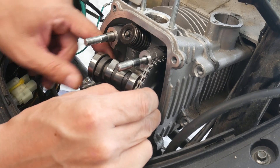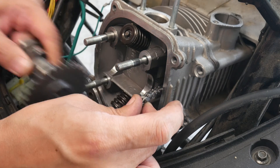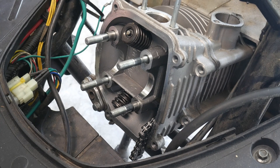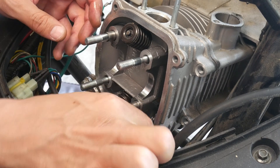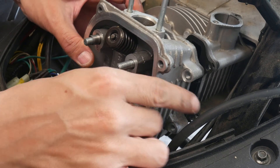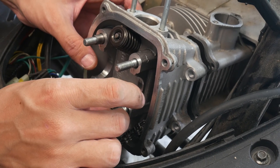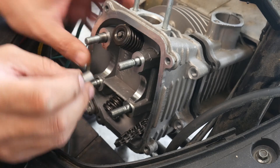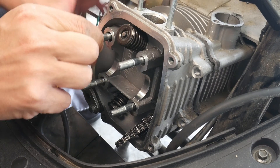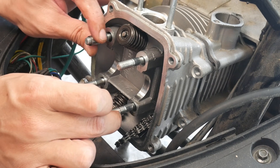Now the chain on the camshaft is loose and I should be able to pop it right out. I'm being careful with this chain — I don't want it to get lost inside the engine. So I'm setting the cam aside and checking everything looks good so I'm able to pull off this head next. As I do, I've noticed I found my first couple of dowels — one on the bottom right and one on the top left — I'll need to remember where these go so they go back in the same spot on installation.